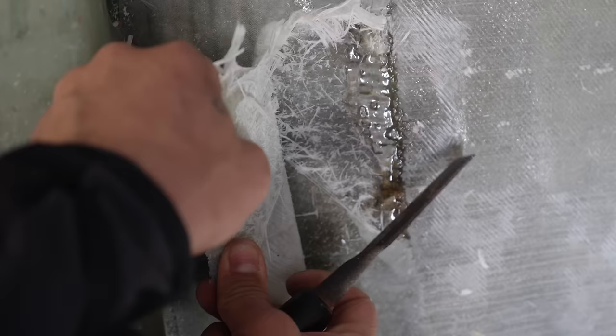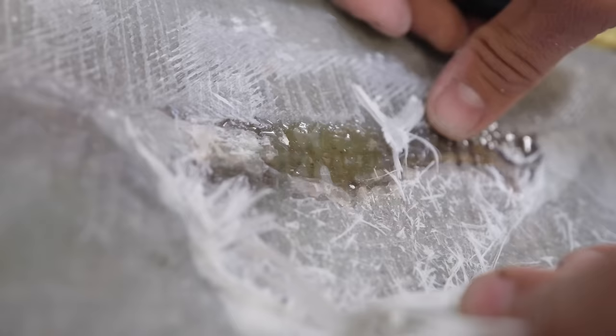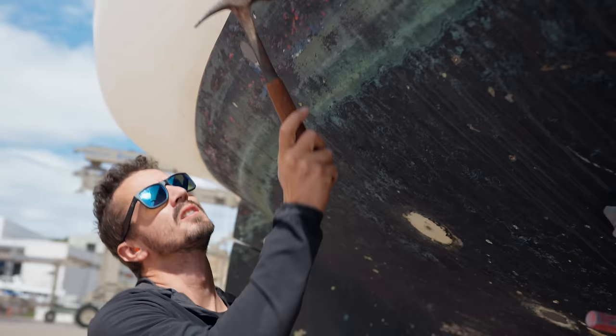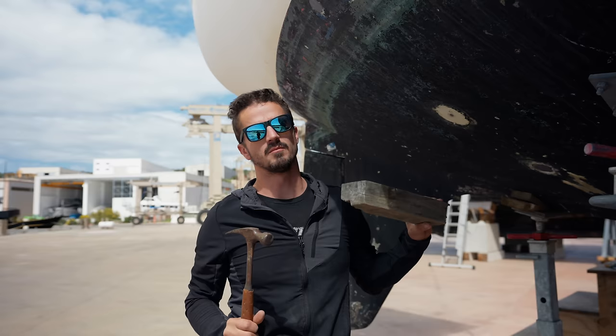We've smacked a chisel into some of the lamination inside just to see if we can peel up a layer and pry it out. Yes, we can get it off, but you'd expect that. What we're looking for was ripping, tearing, crunching and grinding — not just popping off a whole piece. That initial surgical test went pretty well, but we won't feel better until we hit something with a hammer. We're not going to smash it directly like we did with the test piece because that will actually damage the glass. We'll put it through a piece of wood first to distribute the load and see if we can get it to delaminate a little bit inside.